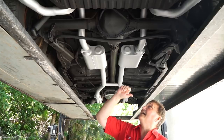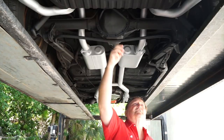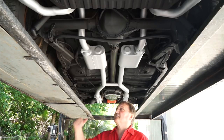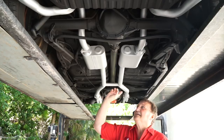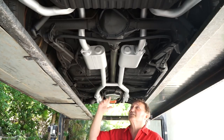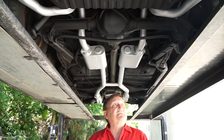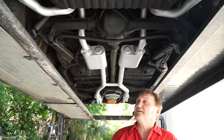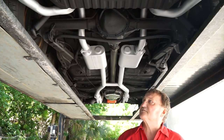Regular springs in the back, the 12-bolt rear, which is also indicative of a real SS car. So we've got F41 suspension, heavy-duty sway bar in the front, sway bar in the back, boxed swing arms, big block Chevy, 12-bolt rear. Nice car. I drove this car for a few days, and it does nothing wrong. This thing talks to you. Fires right up. Nice, runs nice and clean.